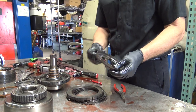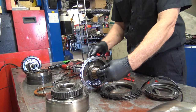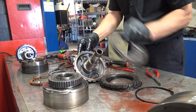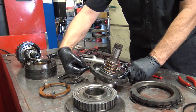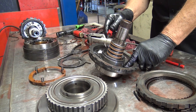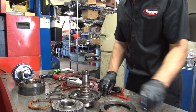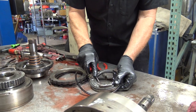It faces out towards the pressure. This has pressure passages — this very big one right here supplies pressure on the inside. This channel goes through and puts the pressure on these passages, which go into the case, then into the valve body, which is the brains of the whole thing. There are two seals on this.